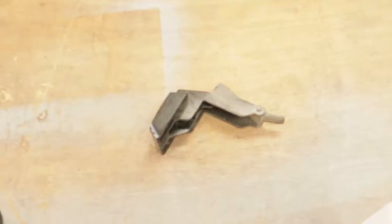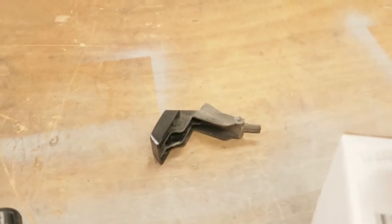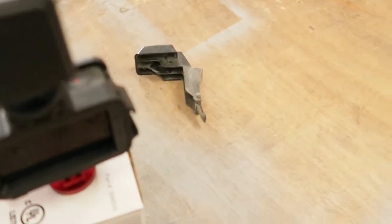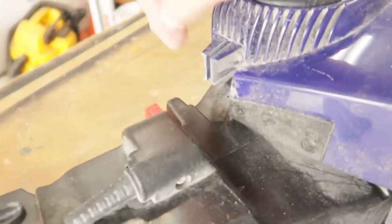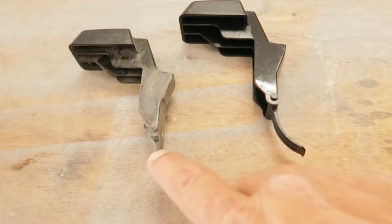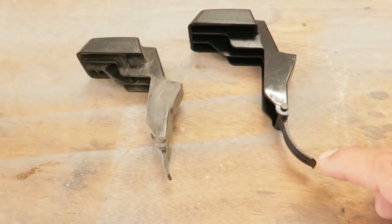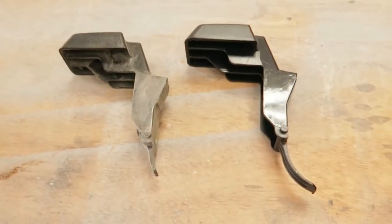And that's all there is. There's the broken one — that tab's supposed to be way down here. So let me pull the new one out of the packet and show you what it looks like compared to the old one. You can see here's our old latch — see how much shorter this little spring here is. This one is broken off, this one is like it's supposed to be. And that's the problem of why this vacuum cleaner won't stand up.